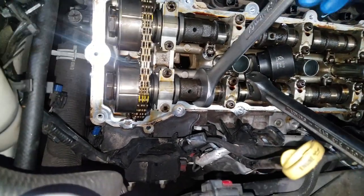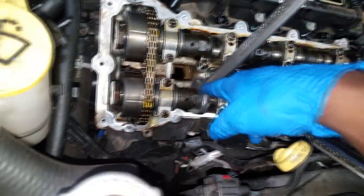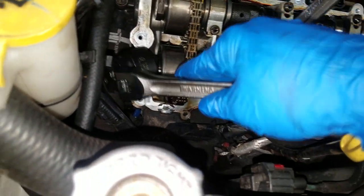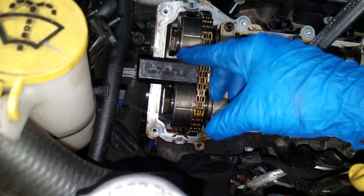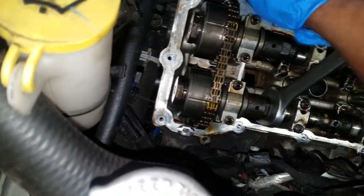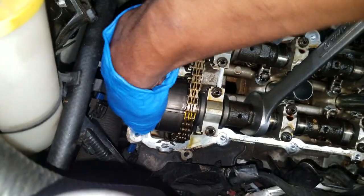Let me show you where I'm at. These camshafts have a hex spot where you can actually turn the camshaft, so I have my wrench on there and I'm going to use my big socket to remove one of the phasers — in this case the exhaust phaser on bank two. Here's the tool you may need: you simply place that in there and it locks the two phasers together, which makes it a little easier to break loose. I already have it broken loose for this demonstration. You simply remove this and the cam phaser will be out of your way, then you just have to remove all the bearing caps — those are T30s.